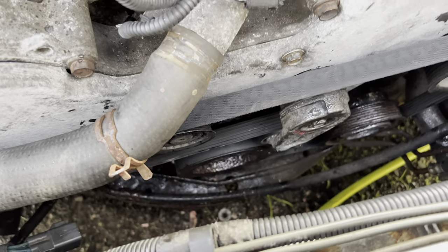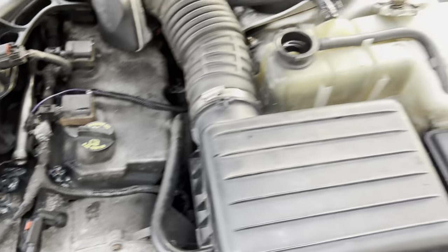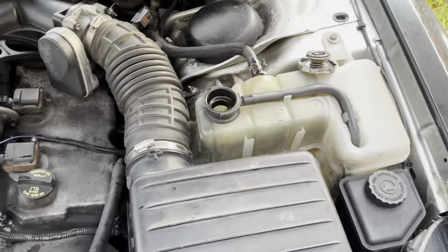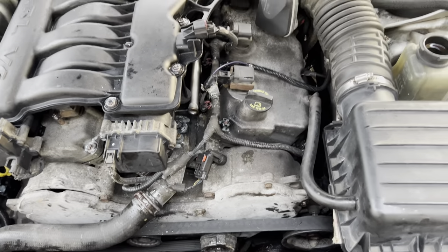Make sure you close the valve on the radiator. I have the fans in and bolted in place, plugged in. Got the coolant hose clamped up. The air box is back in place and tightened. Now I'm going to start filling up the coolant, then start it up and bleed the air out of the coolant system.